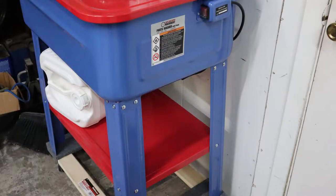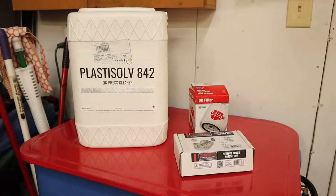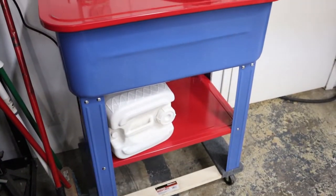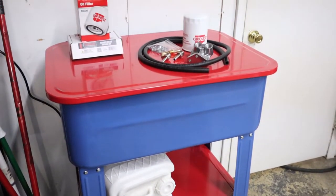Okay, so for this we use the Central Machinery 20-gallon parts cleaner from Harbor Freight. Runs around $80. For our chemicals, we use the PlastiSolv 842 cleaner, and then you can see some of the other parts, which I'll get into more details in the description. This is showing the parts cleaner put together. We put it on one of the Harbor Freight pallets just so it's easily moved around.